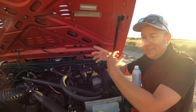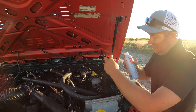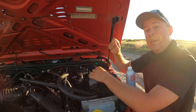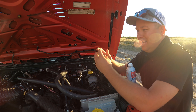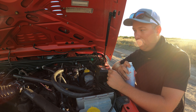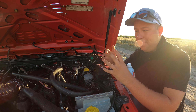Cassie's going to be inside revving the Jeep, holding it around 2000 RPMs. I'm going to slowly pour this in and it's going to suck it into the engine — this goes directly into our intake manifold. That's what creates the vacuum on the brake booster. While we're pouring this in, the engine is going to start stumbling a little bit. We'll continue pouring it while she's revving the engine, and then once we're down about half a bottle I'm going to pour a lot more in there. Once the engine almost starts to die, she's going to kill the engine. We don't want to pour too much at once and lock up our engine — we're essentially pouring almost fuel into the engine, causing it to run extremely rich.